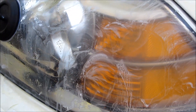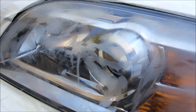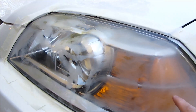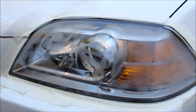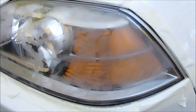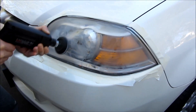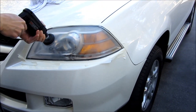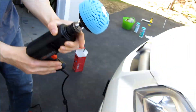That slurry is going to be there and after you're done you'll think you've ruined your headlamps — but that's the way it should be. If you don't feel comfortable having your headlamps in that shape, this kit's probably not for you, but every other kit works the same way. You sand it down and do the progression: 800 grit to 1500 grit, then down to 3000 grit sandpaper.